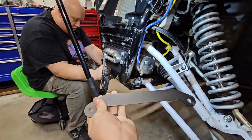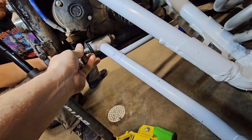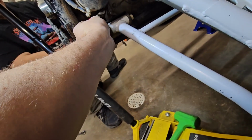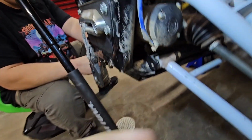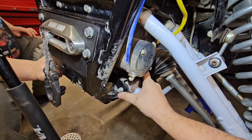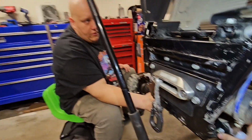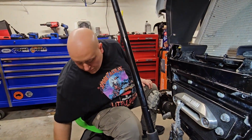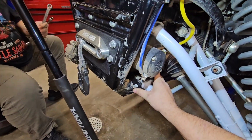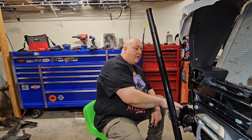All right. So, bracket. Insert bracket. Now, you do not have to remove your wheels. I removed them because I have 35s. We're filming, that's part of it. Now, if you have problems getting the bracket to slip on, which that did not, then lifting it up supposedly helps. You put a jack under it and move it up and down just a little bit.